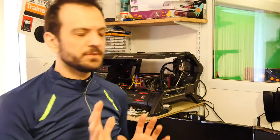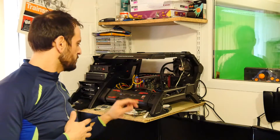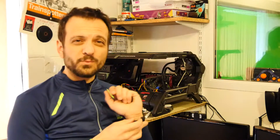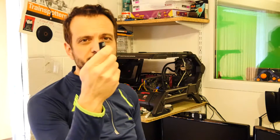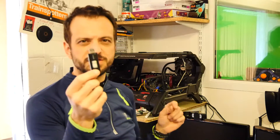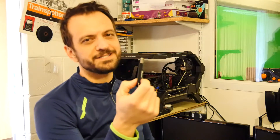The moment of truth - it's all assembled and I put it back together without any problems, but I thought I'd share the power-on with you because normally this is when all hell breaks loose. Turns out I can't get it working. Apparently this motherboard may not like my CPU, so I've got to find another PC because you can put the firmware onto a pen drive, hit a flash button on the board, and it'll update the BIOS. There's a possibility that will get it to identify the CPU.